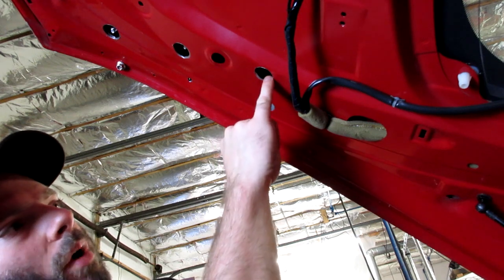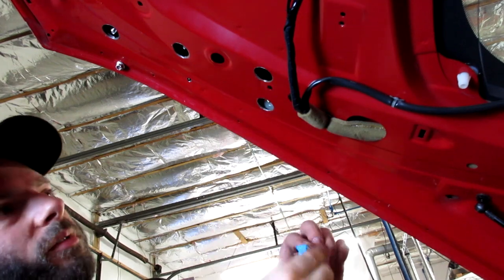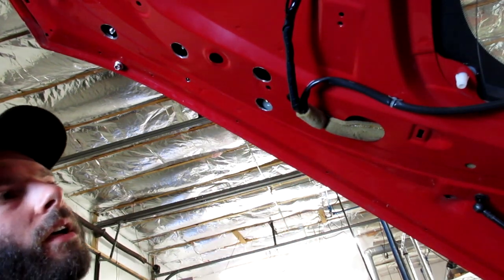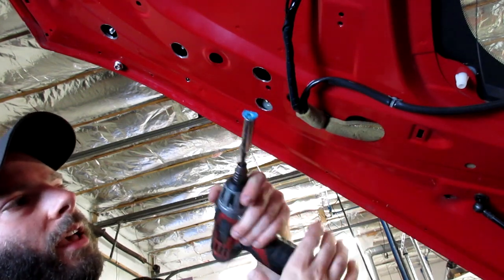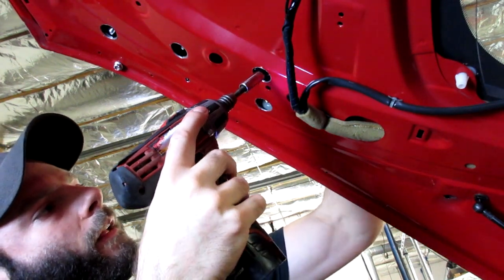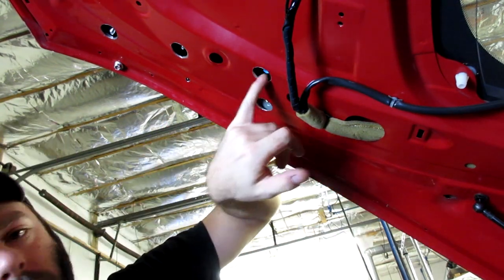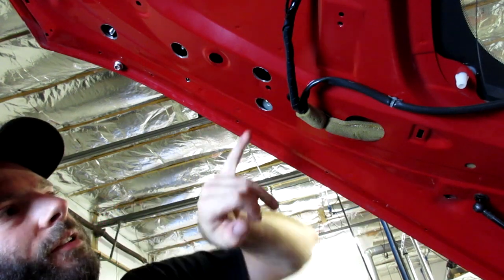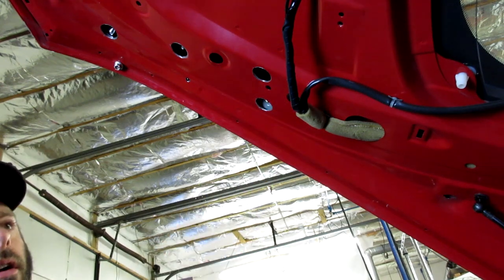In this example I've got to get a washer and a nut up in these holes here, I have a couple of them. You probably can't see the bolts, but they're already coming in through the top. I'm going to take my tape, nut, washer combo — and again, it's not going anywhere. Get it in, get it started, so it's up in there. Now you can tighten it down, you don't have to worry about the nut or the washer falling down into your trunk, hatch, or whatever it is you're working on.